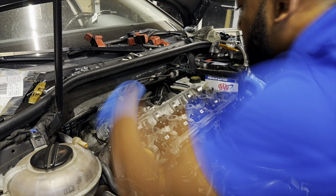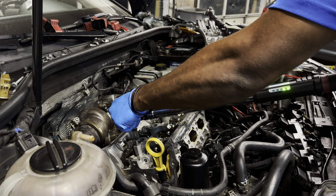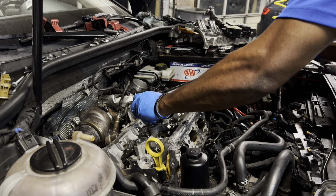After making the physical swap of the cylinder head, things started to lighten up. I was able to whip out the torque wrench, and torquing the cylinder head down in three steps going to 80 foot-pounds, was able to hear quite a few satisfying beeps.